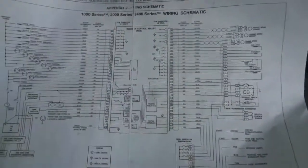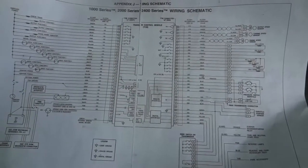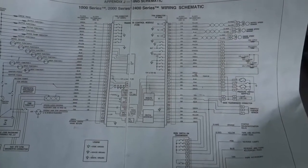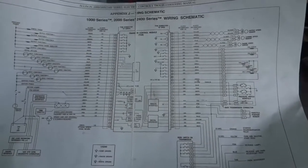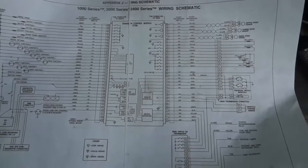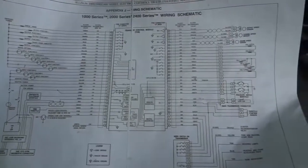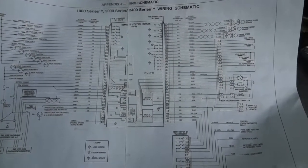All right guys, so I checked everything. Everything checks out okay. Now it comes down to the defective transmission control unit itself. So the transmission control unit is bad. I wish I could really show you what went wrong, but I can't, because everything checks out okay. And I even checked the solenoid at different temperatures to see if we were gonna have a higher resistance.